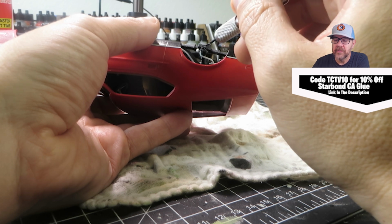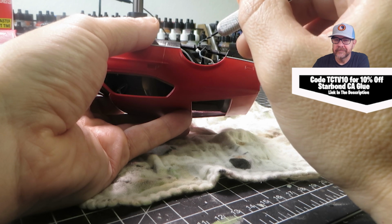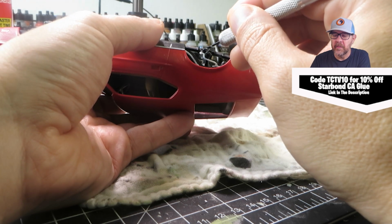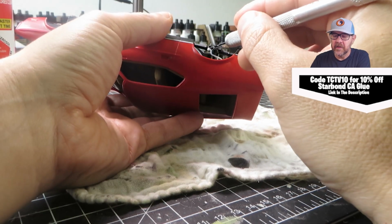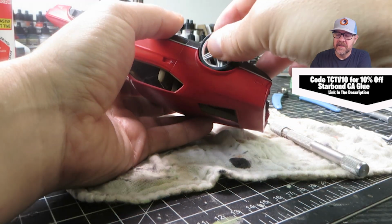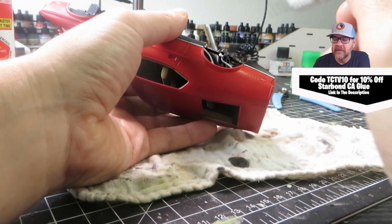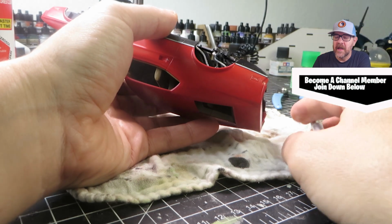That's what I'm going to do. Yeah, so I'll just take a thin piece of round stock, if I make it, or if I just find some, and just make the connection between the sway bar and its mounting point there on both sides. And then I think that'll work just fine. I mean, you're not going to really see it anyways, because it's going to be behind the wheels and the brakes and everything. But I do want to make that connection. I don't want to leave it just hanging here loose like this. So we'll just build a link in between, and that'll work just fine.